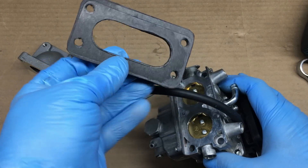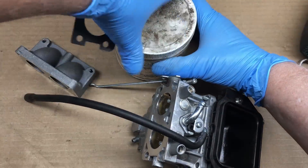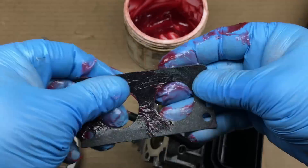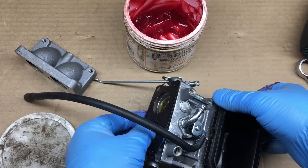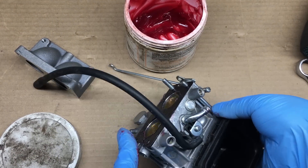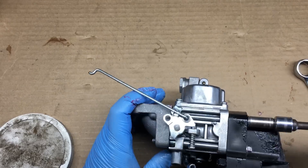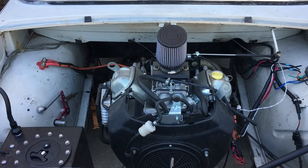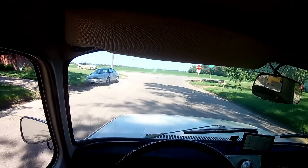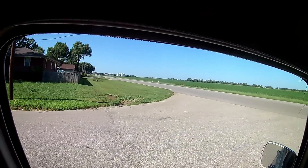Here's the cross-flow spacer that we installed in the previous video. Let's set this aside for now and reassemble the carburetor. Some of the folks in the comment section recommended that I use grease when installing gaskets like this — this is a trick I've seen on a video by Thunderhead289. Apparently, the grease keeps the gasket from sticking to the manifold and the carburetor, and it also provides good sealing properties. A few minutes later, the carburetor's back on the engine. We fiddled around with a few things, and according to the wideband air-fuel gauge, we were able to get an average air-fuel ratio close to 13.5, which is kind of ideal for an air-cooled engine.